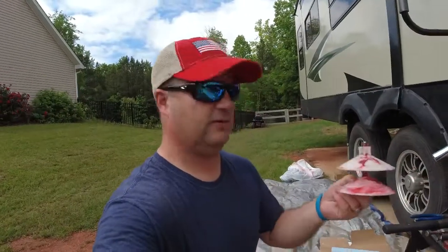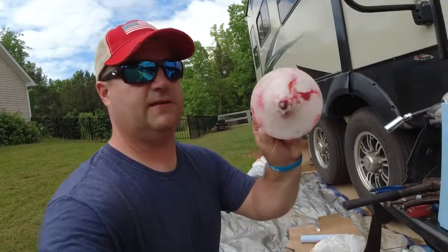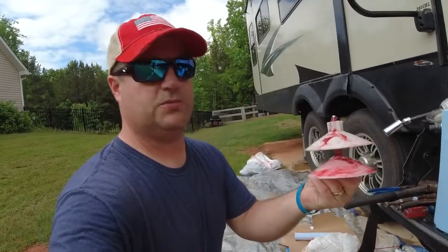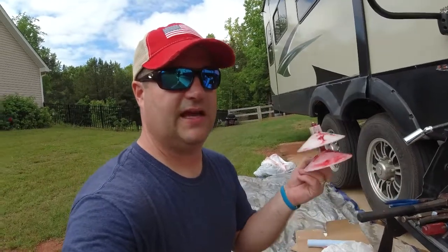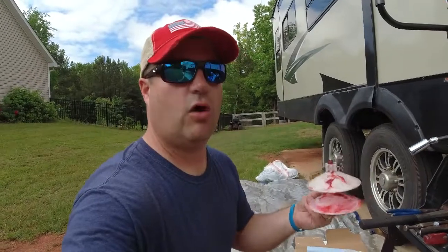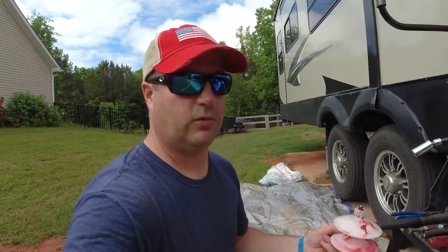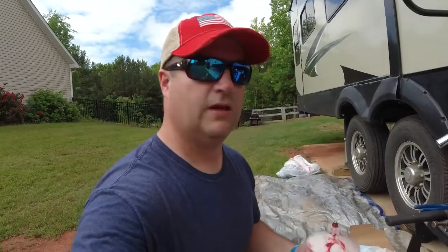One other thing you can do is you can buy one of these packers, and it has a grease nipple fitting here, and you can actually put your bearings between, and it'll pack them for you pretty well. You do need to kind of hand check them, make sure they're okay, and that the grease got all the way through the bearing. That's the real important part. So we'll talk about that in a few minutes, but this could be a helpful tool if you want to use it.